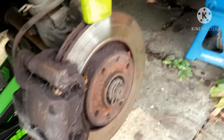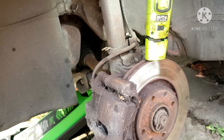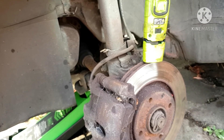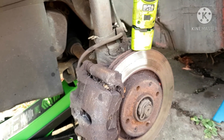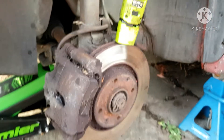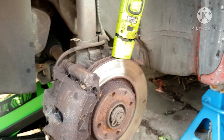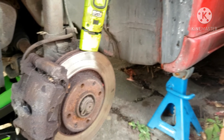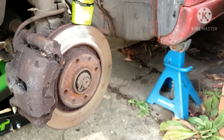That's usually where cars get your speed for the vehicle — it takes an average of all four wheels to let you know how fast the vehicle is going. It also lets you know if a wheel locks up, then the ABS kicks in. Also, some systems use it for their TPMS. They use the ABS sensor and calculate it through how fast each wheel is moving — if a wheel has less diameter it moves a little faster, and then the system will say the tire's low and kick up your TPMS warning.